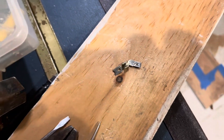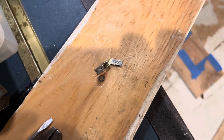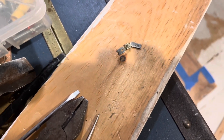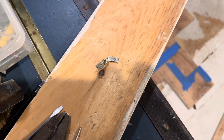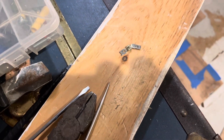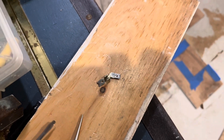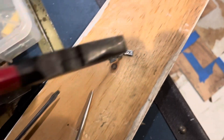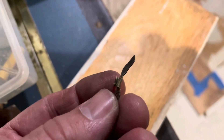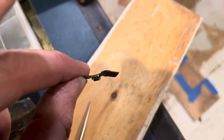Another option is soldering the wire on, which would involve having soldering supplies and knowing how to solder. I didn't want to do that with the gas tank right there nearby. Also a safety point: be careful putting a lot of pressure on the pliers because it slipped off a few times and almost went right through my hand. Use a pair of pliers to hold it while working to keep your fingers away. And don't go too hard on it — you don't want to break the connector, or you're really stuck.